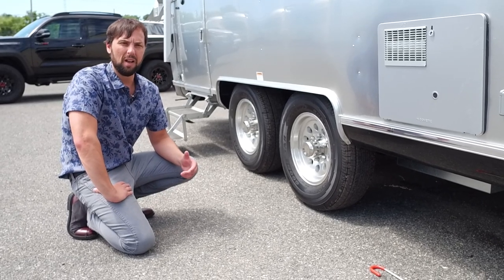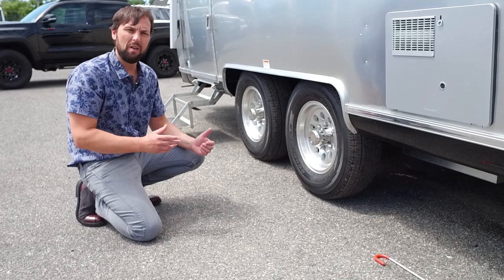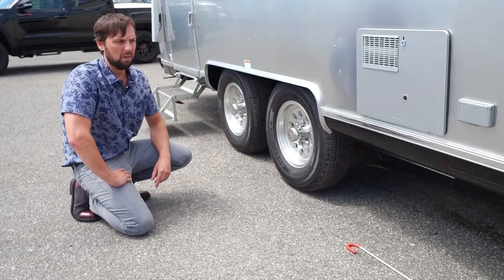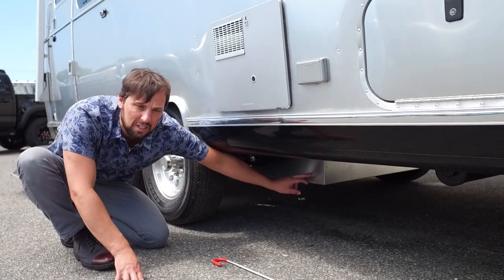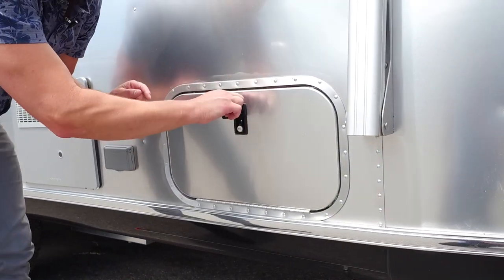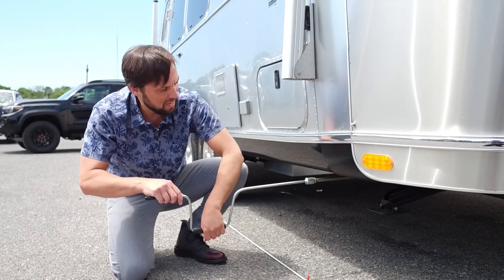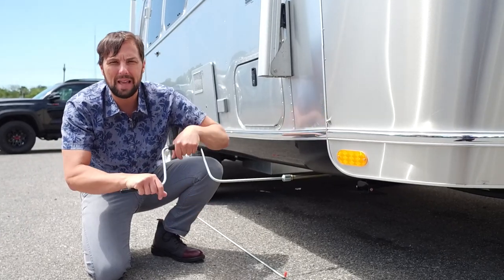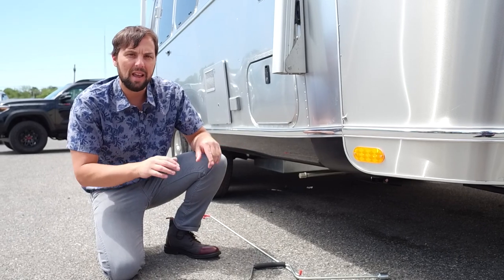You also have never-adjust brakes, though it's still recommended to periodically check the brake lines and hardware inside. There's a rubber torsion axle system — very low center of gravity, fewer moving parts, no wear and tear. Axles should last several decades. There's a shock absorber at each wheel. The underbelly is completely enclosed in aluminum with insulation below and tanks in insulated chambers. Heavy-duty stabilizer jacks at all four corners — these are stabilizers, not leveling jacks. To level the trailer, use leveling blocks under the tires, then put the jacks down to stabilize.